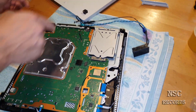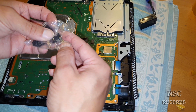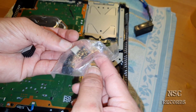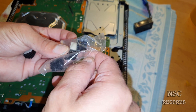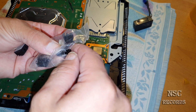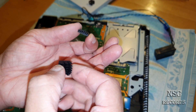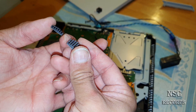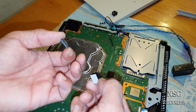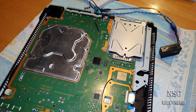I'm going to pass the smartphone again. Here also, like I told, these are the smaller coolers here. I bought them a long time ago and they are really thin. I can show you the difference between a higher one and a thinner one. I don't want to touch them because they have a glue under there. You can buy them also with copper - the heat transfer will be even better. The one on the right side is very high and the one on the left side is recommended for the PlayStation 4, because if you put the taller one in there, you will not be able to close the case again.